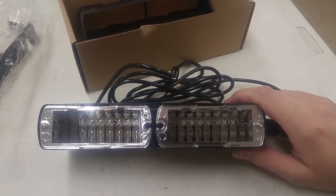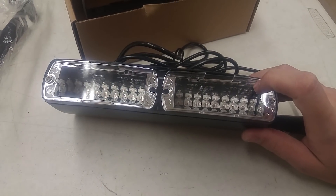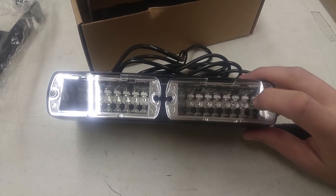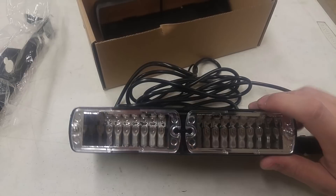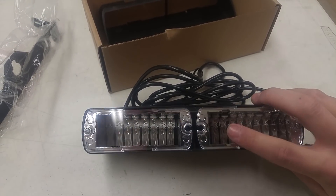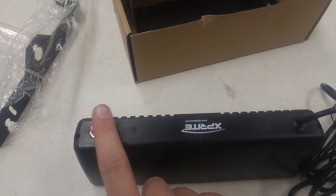You can tell just by the look of it — I automatically know just by looking at the front that this is the fake Viper. It has the same design as far as the optics: LEDs at the top of the light facing down into a reflector and bouncing out. Federal Signal's Solaris technology is built exactly the same; it's just the LEDs are different and the fluting in the lens is different. Another thing to tell the difference: on the knockoff ones, the button is not recessed — the Federal Signal one is recessed into the housing of the light. It's still accessible to press for the flash pattern, but it's recessed instead of protruding out.